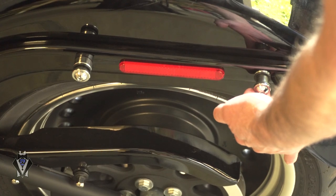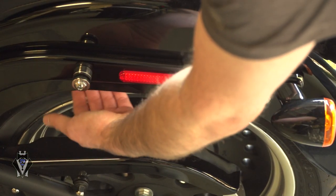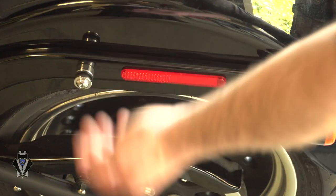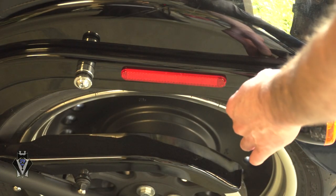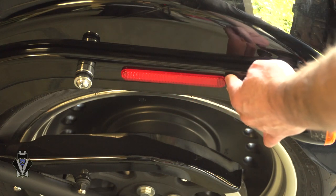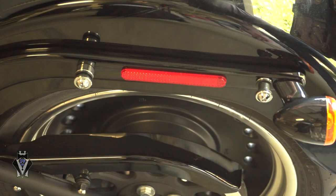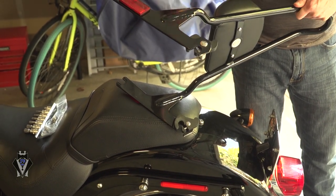The docking kit install is really, really simple. There's nothing in the back you need to worry about — it's a stand-in-place bolt back there, you just screw these in and tighten them up and you're done. You also don't have to take the side reflectors off. The sissy bar actually covers them up, so it's fine — you don't need to do anything with that.